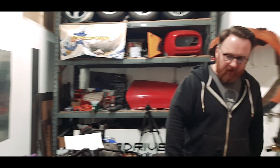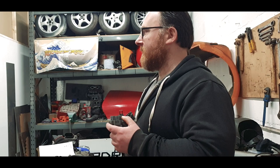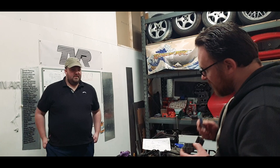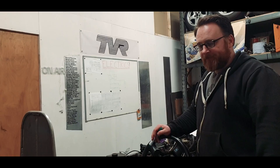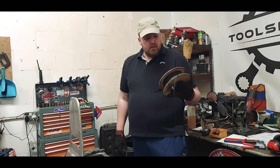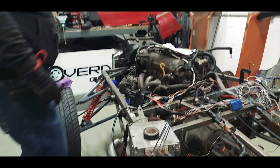How this old-school pre-OBD diagnostic port works is: you read the manual, and the manual will tell you which one of these you bridge out to test. That's how the diagnostics work in the old cars. You'll also have a way to pin these out that will cause a bulb to flash a number of times to tell you what the fault is. There is a pin that we'll be able to bridge from one to another, and what that will do is literally earth this from the fuel pump on. So I need you to wire them out from your fuel pump - we're just feeding through enough electrical wiring so we'll have enough leads at the front to connect it to whatever it's going to connect to. All I'm going to do is terminate it and connect it to the fuel pump.